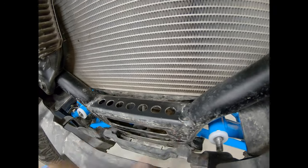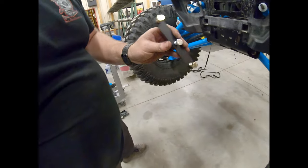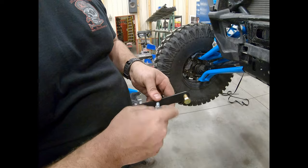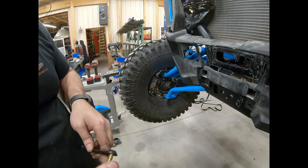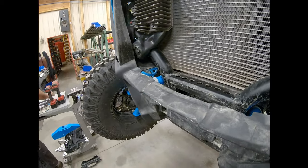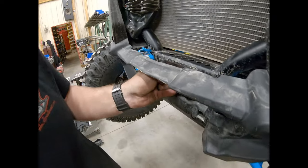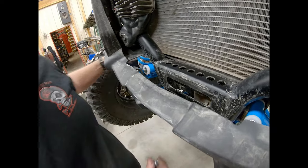While we've got this plate off, before we put ours on, to ease up the process a little we're going to take our upper mount bracket and loosely put it in the frame — we're not going to tighten it down, just leave it loose to hold it in place. It goes up through here; it's a little tricky to get through this front hole, but you can always come from the bottom or from the back.